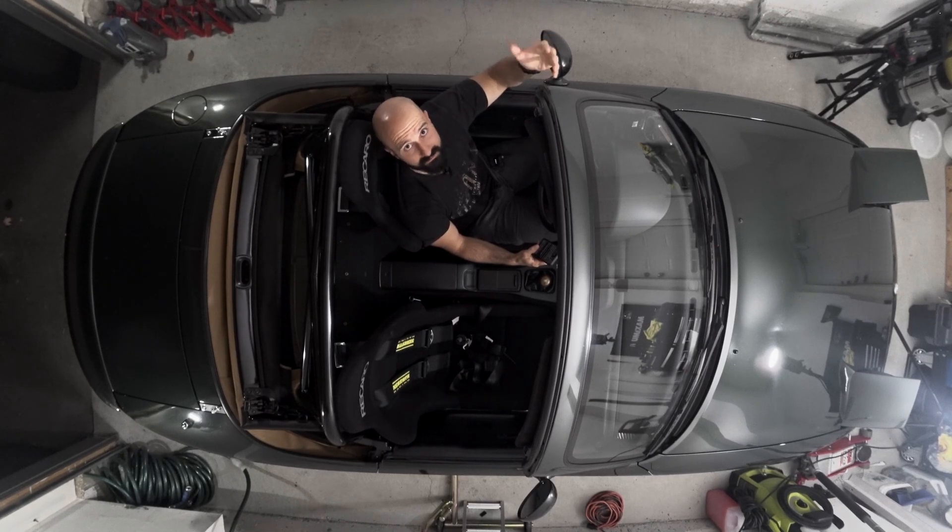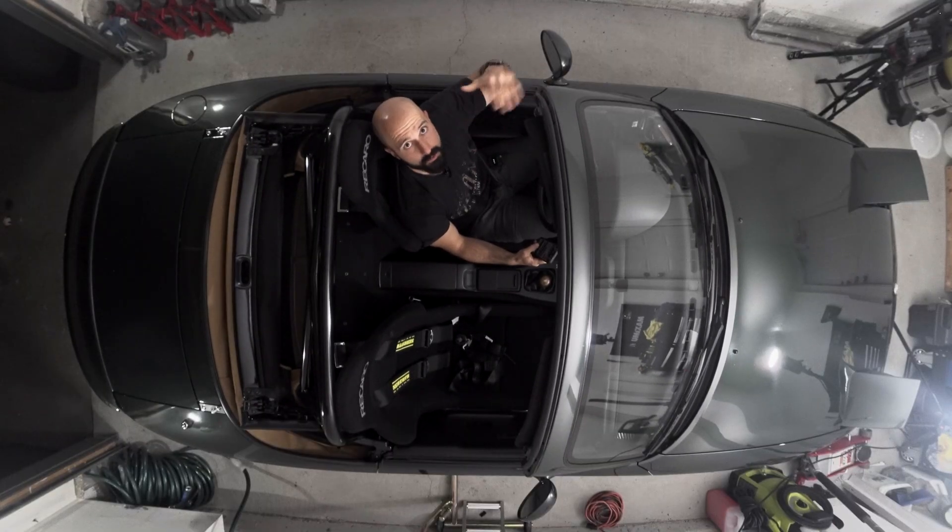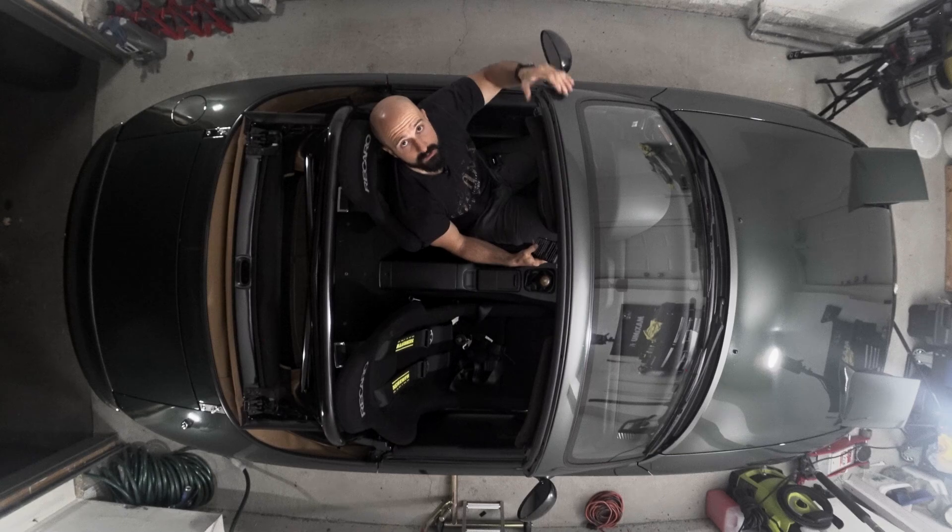If it's a rear-wheel drive car and it's a bit tail-happy, you'd want to reduce oversteer and do the opposite. For this one though, I'm changing both because I just want to get rid of body roll altogether. I want that crisp steering feel, but I also don't want to throw it off balance, so I'm making the rear stiffer too. That should reduce overall body roll. This car only has 100 horsepower, so a little oversteer would be fun. Let's install these bad boys — I feel like I've already talked too much, and this camera angle is really hurting my neck.